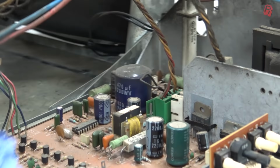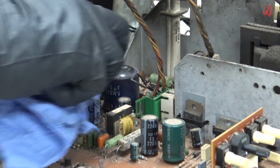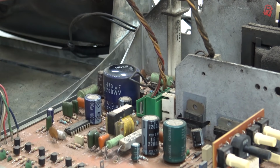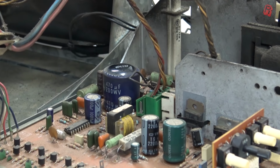Once that tray is clear of the monitor, the first thing we did was to inspect the bulging capacitor, and after a quick wipe of the capacitor, our initial confidence that it was the cause of the problems was dampened a little because it wasn't bulging at all. That's just a plastic cover on top of the capacitor. That would have just been too easy, wouldn't it?